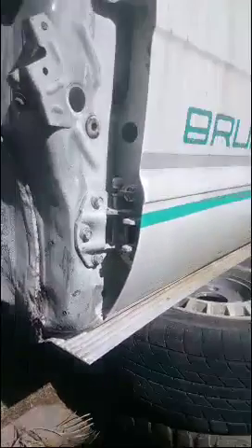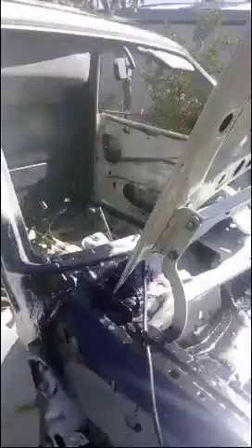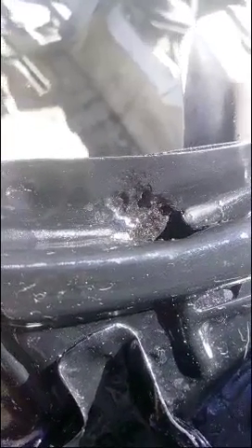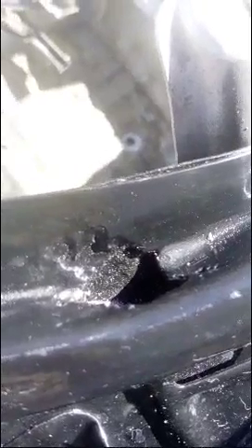It becomes beyond economical repair at that point, so it's worth pulling a windscreen out to check and clean up because you can guarantee there'll be something. This one was amazing even though it's been sitting for five years without use or care. On the right-hand side — the driver's side here in Australia — you can see the rust had nearly started to take hold of this hole, but now that it's been sandblasted, treated with acid to neutralize it, and repainted with cold galvanizing, it's fine and stable. That's not necessary to weld up because the windscreen sits right over it, and more drainage the better.